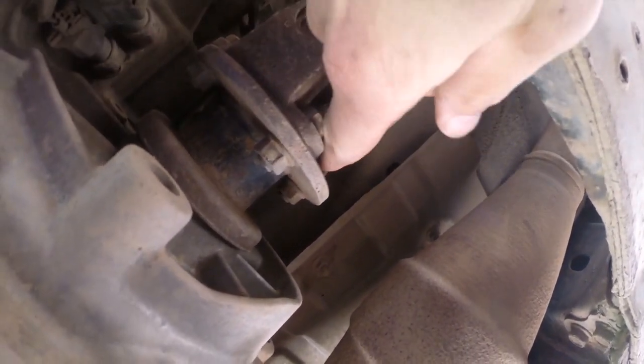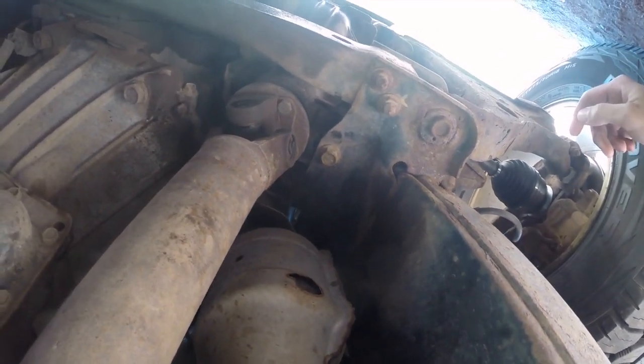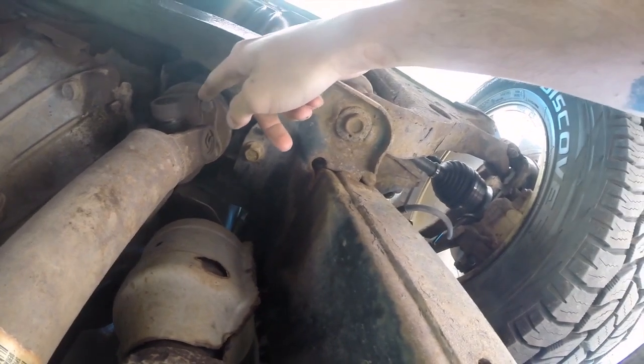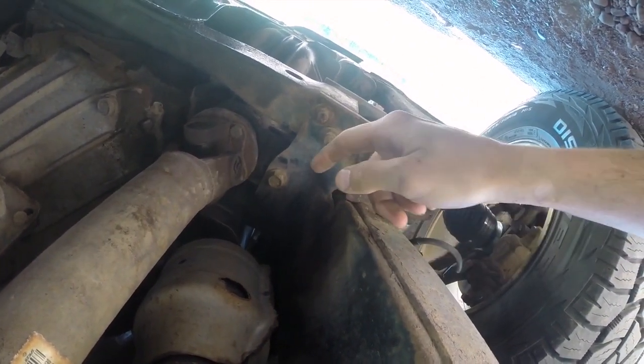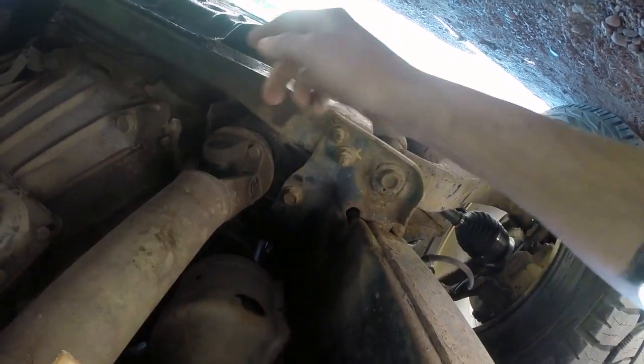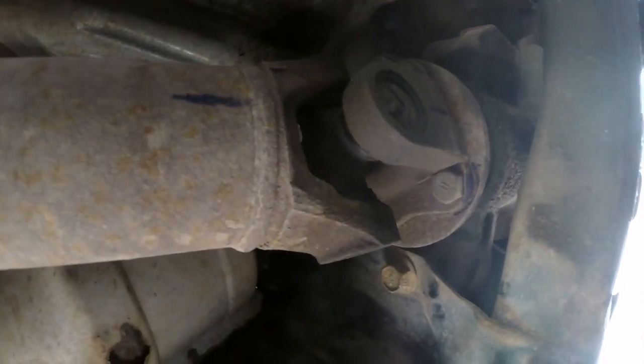There are four bolts here and four bolts on this side. I'll let the truck down on the ground. I do have it blocked so that way it's not going to roll accidentally. I can get at three of them and then I'll have to roll the truck forward a little bit to get at the fourth. First things first, I'm going to mark the alignment of the drive shaft so I can get it back in the right orientation. I marked the position of the flange and also the yoke of the drive shaft, and I did it on the other side as well.